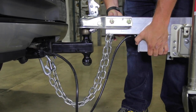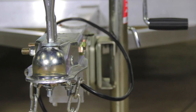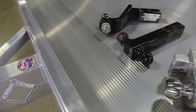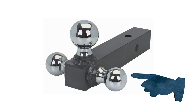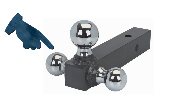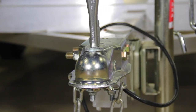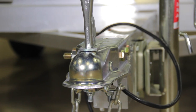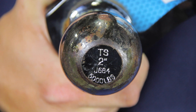There are several steps to attaching a load. First, check the size of the receiver ball and hitch. There are three standard size balls for pulling trailers: 1-7/8 inch, 2-5/16 inch, with the most common size ball being a 2-inch ball. Located directly on the top of most balls is a small imprint of the size of the ball.